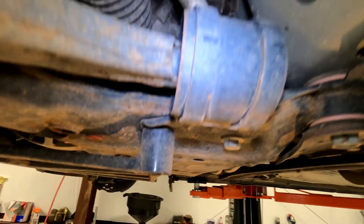I use a jack to support the control arm a little bit so it doesn't fall out of that groove. I pulled down on it and rotated it over. Now I'm gonna take a rubber mallet and pop it so I can get this bushing inside of here.